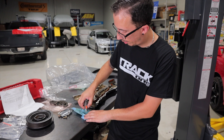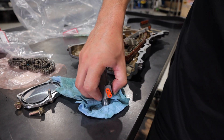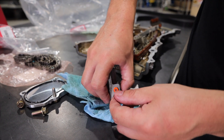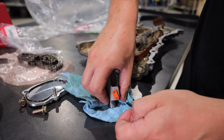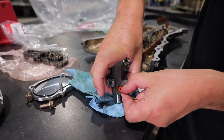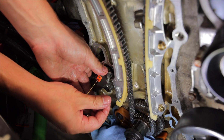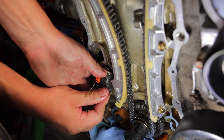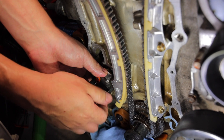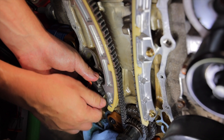Since we're reusing the old tensioner, we can always bring the piston back in. All you got to do is pull the pin out, let it out a little bit, push down on the lever, put the bottom one on first and then kind of lift it up and push it out of the way. So full tension, and then we'll release the pin.